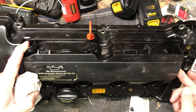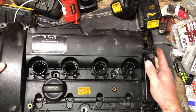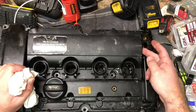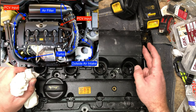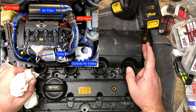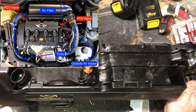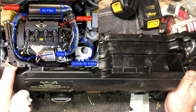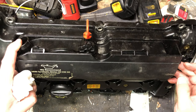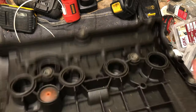There's one input here and one input on the side here. This one plugs in basically where the air filter is - I'll put a picture up and circle everything. So this is going to be getting pre-turbo air, or pre-turbo suction. This one is going to be getting post-turbo suction. This one plugs in before the turbo, and this one plugs in just before the intake manifold.